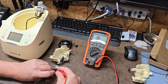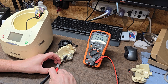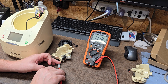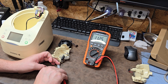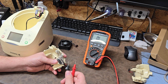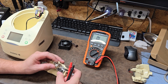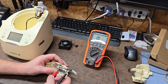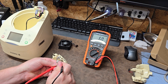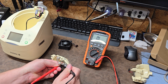First step: we check for continuity on our leads, then by placing the leads down inside the pin connectors we get 112 ohms. Hmm, that is extremely odd. It doesn't matter though - these heating elements are traditionally around six ohms. There it is: six ohms. So why did I get a different value when I went across it?